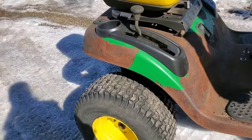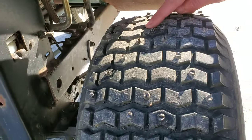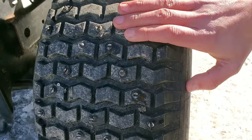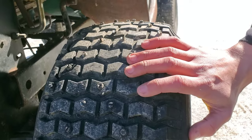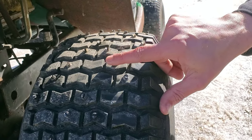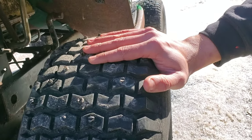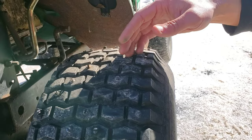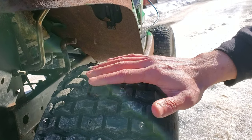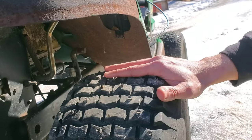On the rear I did the studs in a V pattern, just like the original video I posted. What we're going to do for the last race is cut out all of the unstudded lugs — every single one — because once the track got stirred up and there was a loose layer on the surface, I couldn't get grip with the turf savers as well as before and I started losing rear end traction. So we're going to cut out every other lug and go from there.